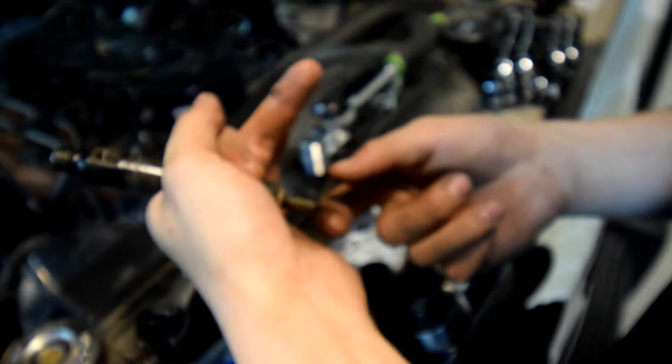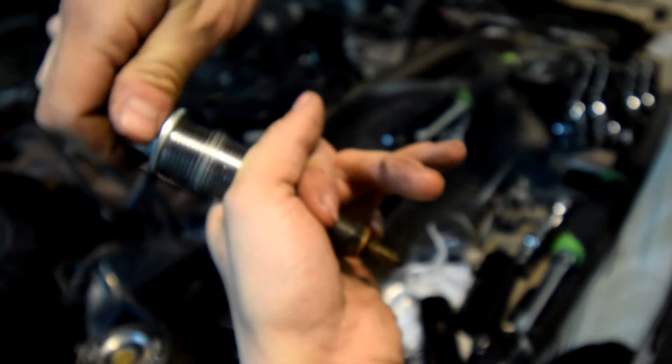For those who don't understand what's happening, here's a quick visualization. Assume this is our cylinder head and this is the injector clamped in the head — the injector's stuck. You can try pliers or vice grips but you don't want to mess up the threads, especially if you plan on reusing them. A lot of times wiggling doesn't work. So the pipe goes on here over the injector threads. The washer and lug nut go on top. As you tighten this down, it pushes against the cylinder head, which pulls the injector up.